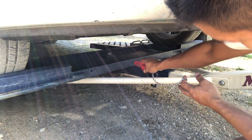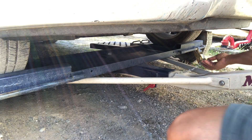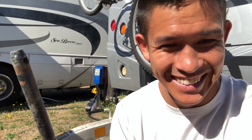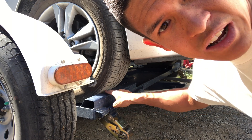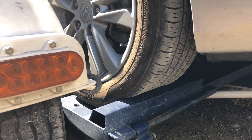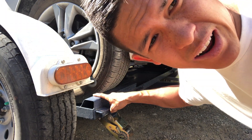This is the point at which I like to put the ramp pin back in — I'll double-check it later, but it's very critical. When bringing the car up on the car dolly, I bring the tires all the way forward, but then I just barely dimple the tire onto the stop block. That way, when I'm tightening the tire straps down, I know it's got a nice snug fit.